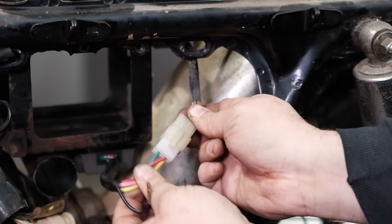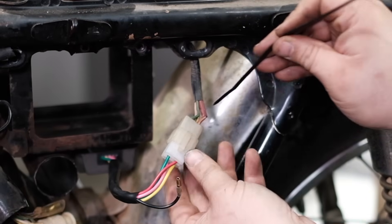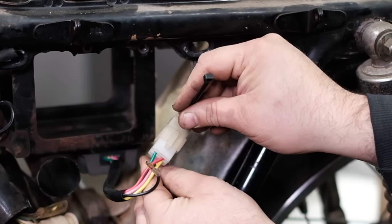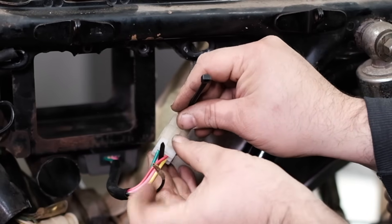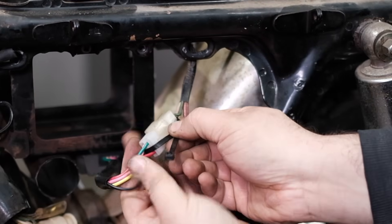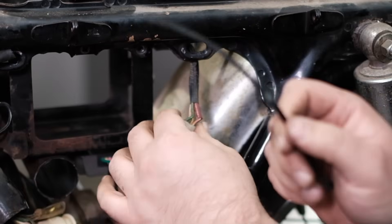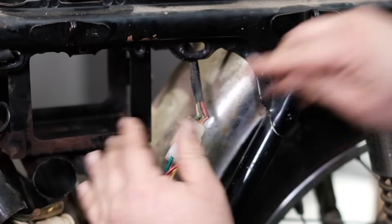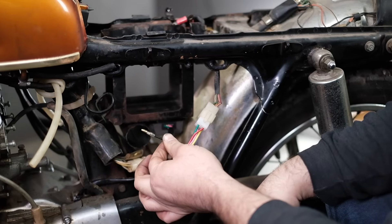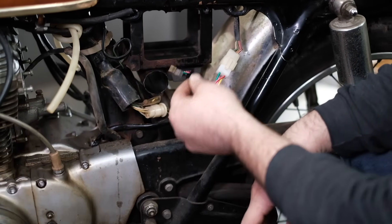If it's fitting a little loose, you might want to take a zip tie and come around like that and zip-tie it shut in that manner in case they're loose, or just go ahead and change out the terminal. That one feels pretty good — I don't think it's going to go anywhere. Now we're left with this single black wire.